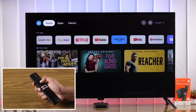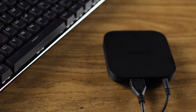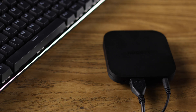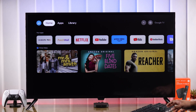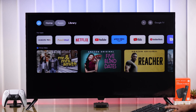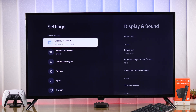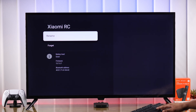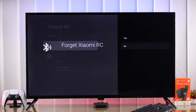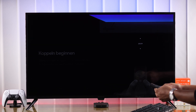If your remote still won't pair or you are not seeing the pairing pop-up, then we can try forgetting the remote from your TV box by using a wired USB keyboard. Just insert the cable into your Mi TV box's USB port and it should connect automatically. Then using the arrow keys, highlight Settings and press Enter to select. Go down to Remotes and Accessories, select Xiaomi RC, select Forget, and press Enter on Yes. Now you'll be able to re-pair your Xiaomi remote without any drama.